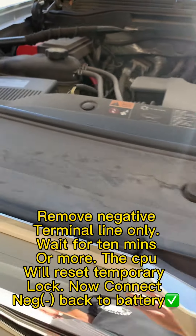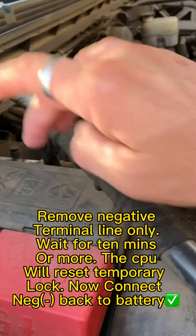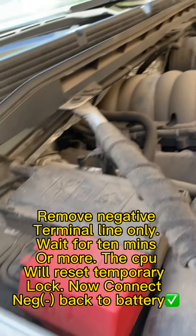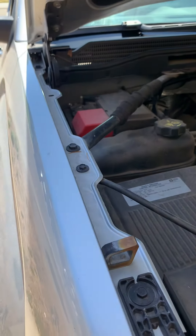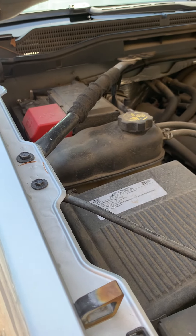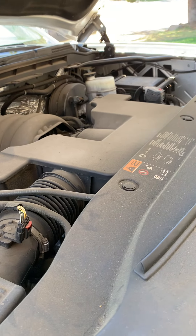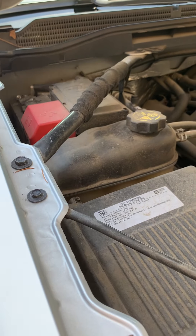Essentially, here's what I did — took about 10 minutes and my car was up and going. All I did was open the hood, pull just the negative off the battery — I left the positive on — pulled just the negative off, and let it sit for 10 minutes. That's it. This is an easy fix for anything that has a computer system in it — a brain, a motherboard, whatever you want to call it. It's just going to reset the system, reset everything.